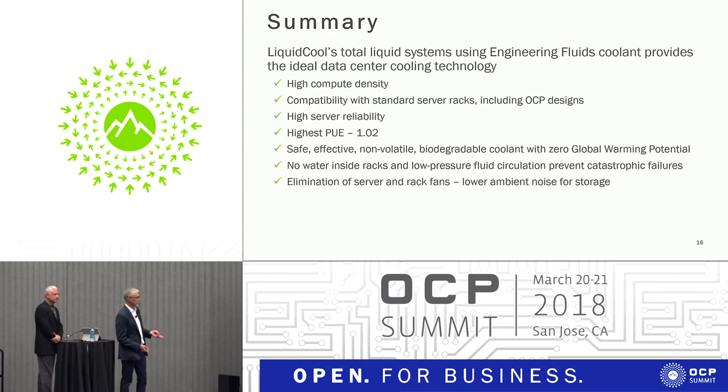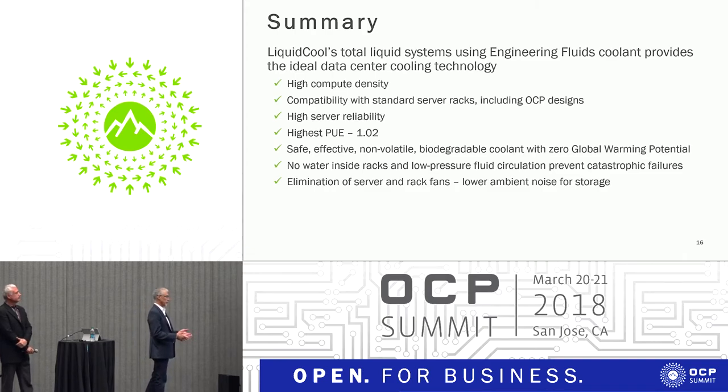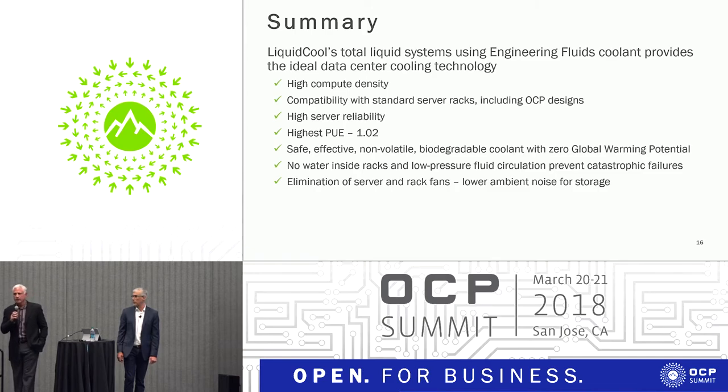Inside the server, you've got to consider what I'll call the skew of the fluid itself and how you manage that, the pumping system moving the fluid through the server, and then the hard drive — which hasn't been fully solved yet, but we're beginning to talk to companies about it. For hard drives, you definitely want to use sealed hard drives. The fluid doesn't actually damage vented drives, but the arms inside were never designed to move through the viscosity, so they create a tremendous number of errors. We've had three helium 10-terabyte drives under fluid now for a year — they're fine.